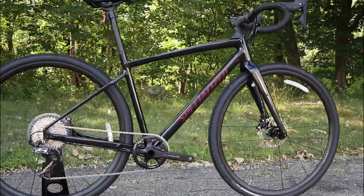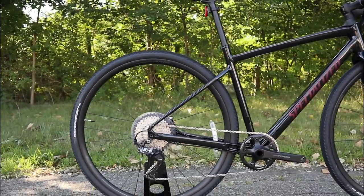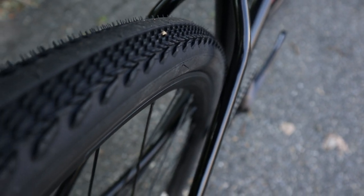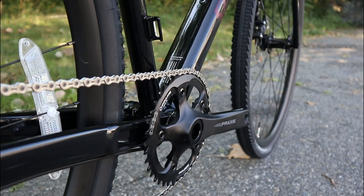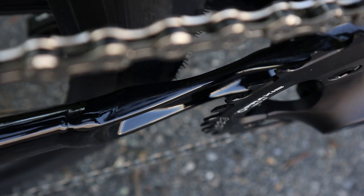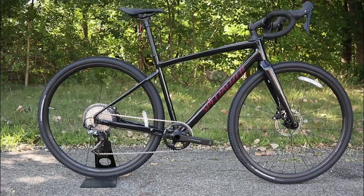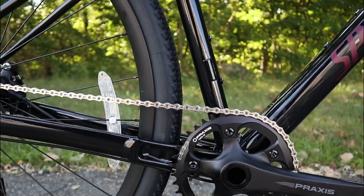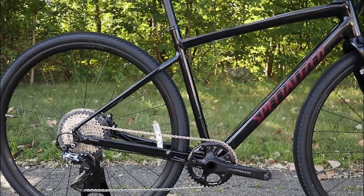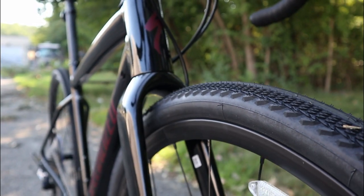The other incredible thing about this bike is going to come in with the rear end. This bike has huge tire clearance — it can run 700 by 47c tires in back, which is a whole ton of tire, or 650b by 2.1 inch tires. Part of the way they're able to do that is through this aluminum beam construction between the chainstay and the crank. Specialized claims they wanted a straight chainstay as they find it's stronger than having drop stays or that arc that goes over the top of the chainring. To run a large chainring with tire clearance while still having the tire tucked tight into the back end of the bike, they needed to make that beam construction. On their carbon versions, that part of the bike is a solid piece of carbon.